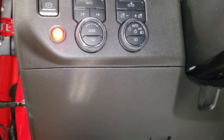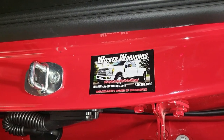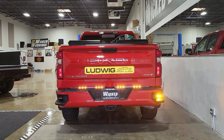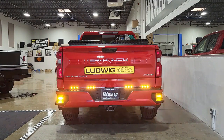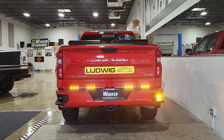Let's kick this back on and show you what the rear looks like. Always keep in mind these stickers on used vehicles — if you see them, they were through my shop. Around the back, we built to spec. This owner really likes the amber lights underneath the tailgate, so that's what we gave them. That's two 28-inch Thin-X strips set on a fast alternating pattern in amber. They are set in 28-inch lengths because you can fill basically the whole bottom of the tailgate with light. It's an amber-white product, so you could do white flashing, but with his branding being reflective amber, all amber looks a little nicer and it's quite bright.